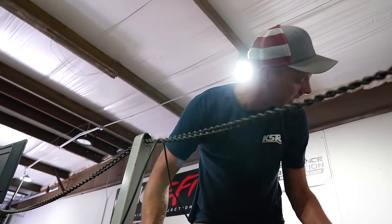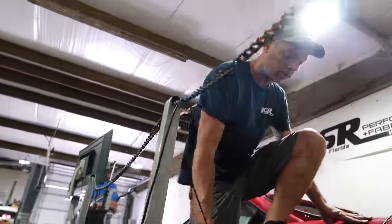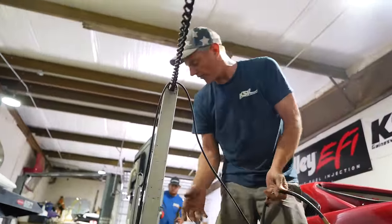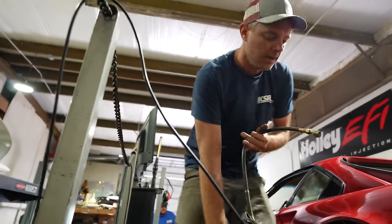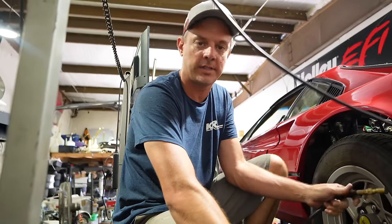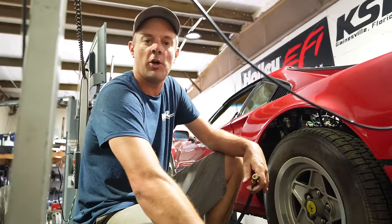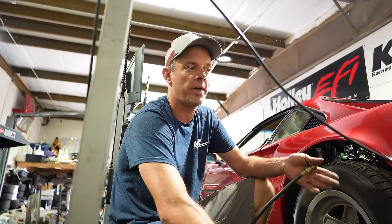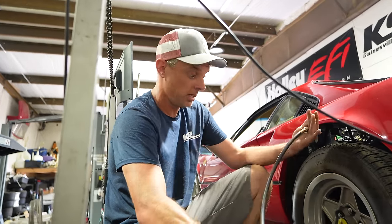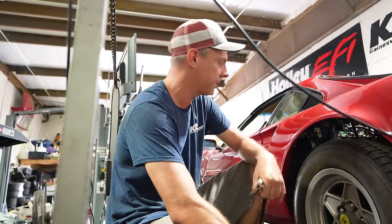As long as your dyno consistently measures the horsepower to itself, whatever car you've got on there that day, that's fine. But comparing numbers across different dynos is not a smart thing to do because every dyno reads a little bit differently. The correction factor may be a little bit different because of the weather conditions, like it's 95 degrees and 80% humidity today, so we're sweating like crazy.